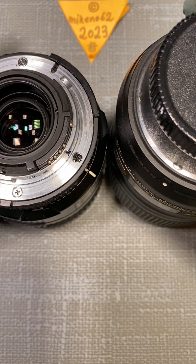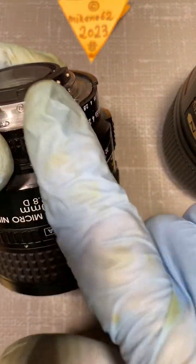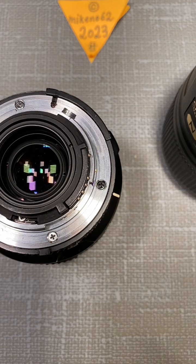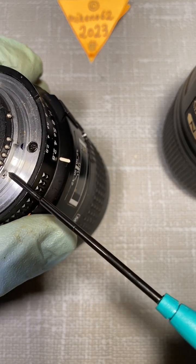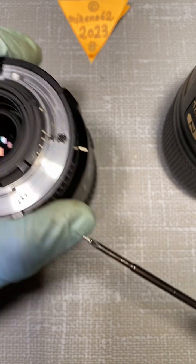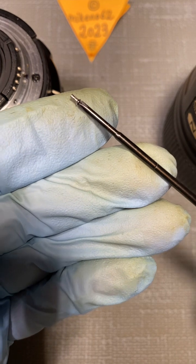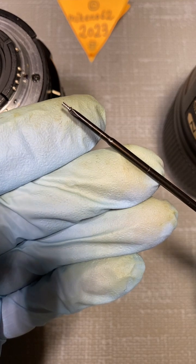Let's have a look at the AF lens. I will unscrew the one screw here — the other is already out, just to show the difference, which I will come back to shortly. Use a JIS 2 millimeter screwdriver, not Philips, and unscrew it. And it looks like this. Hopefully you can see it — I just used my iPhone for this video. You can see the cross-cut thread.